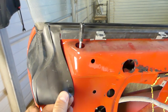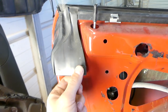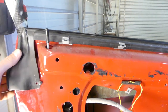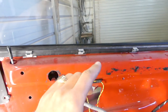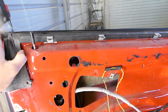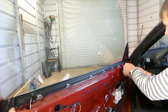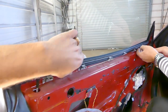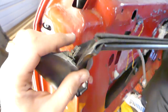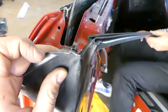We need to pull that seal out. That clip you can remove it or gently pull it out, or you can later slide it over it because sometimes you'll break it if you try to remove it. This right here needs to go up in a very straight way - otherwise if you deform it or bend it somewhere, it's not going to work when you install the window and you can hear weird noises when the window goes up and down. We have to lift it everywhere at the same time.